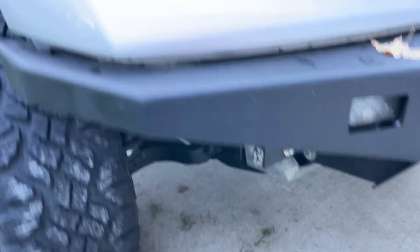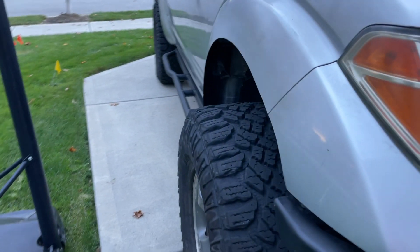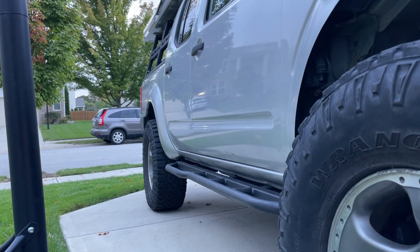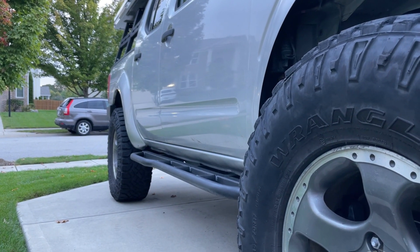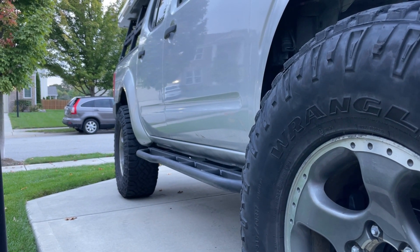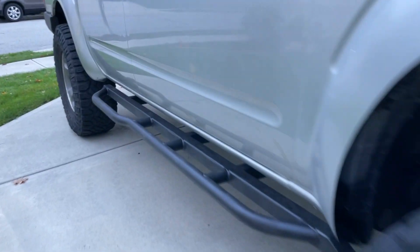It is currently riding on 35-inch tires all the way around. The rears, in order to basically come close to the fronts — and you can see here the Titan swap makes it really wide in the front and even the back doesn't quite keep up with that — it's on a two-inch spacer back there. He swapped in an M205 diff out of an off-road trim, because this truck is actually an S trim. That is also run off of the S-Pod. On the S-Pod you can actually manually switch the rear locker electronically on and off without having to be in four-wheel drive, which is kind of a nice little feature.